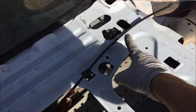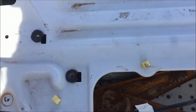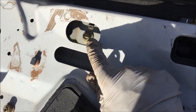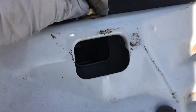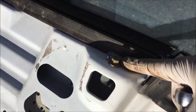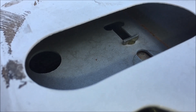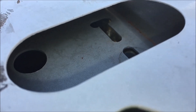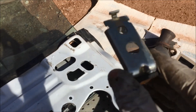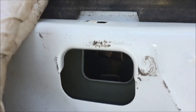Going across the top of the door there are four window stops. There's one here, one on the opposite side, one right at the very top of the window sill, and the last one is over on the corner of the door towards the top. These are all 11mm. To remove them, lift forward on the stop so it goes through the notch and can be removed — just up and out. Remove the bolt up top and it'll push through.